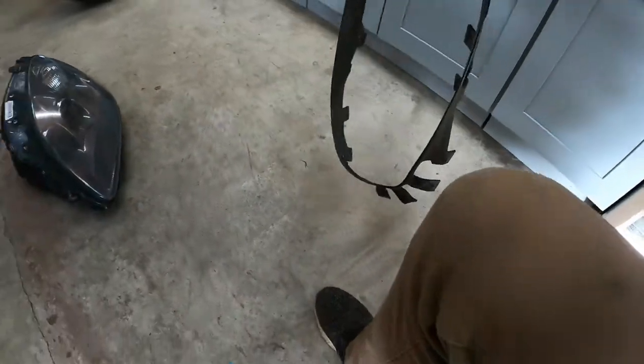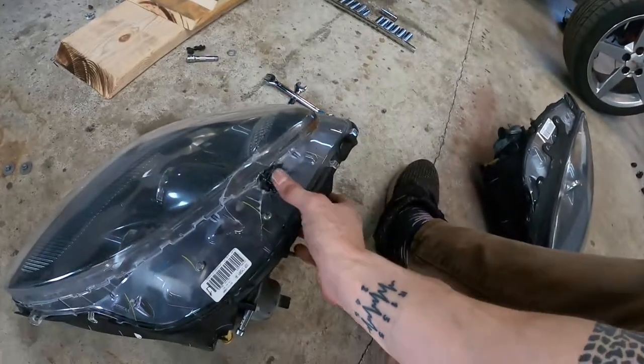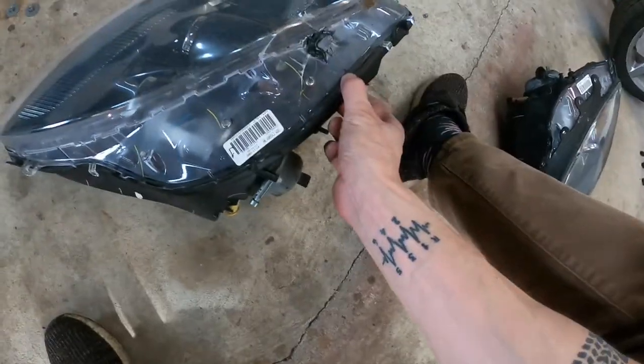The gasket that pulled off is actually just a sealant between the headlight and the car. It looks like I'm going to have to put these in the oven and bake them. If you don't know what that is, you heat the headlights up in your oven set to 200 degrees for about 15 minutes, just enough to heat up the sealant inside so you're able to split the casing apart and remove it.